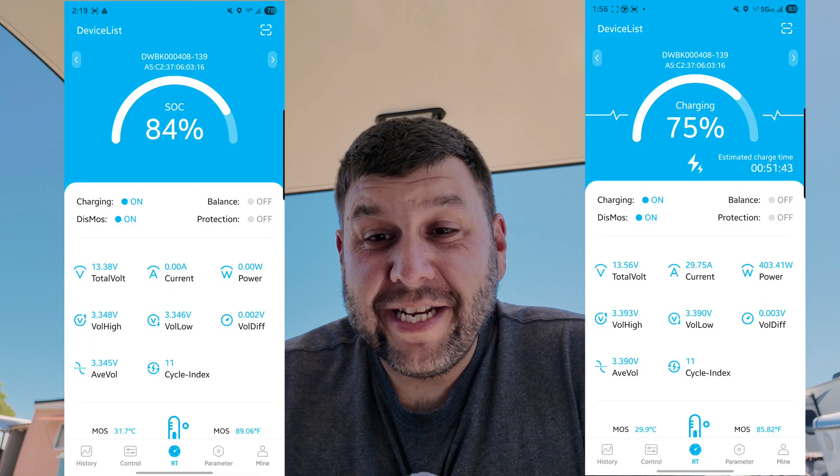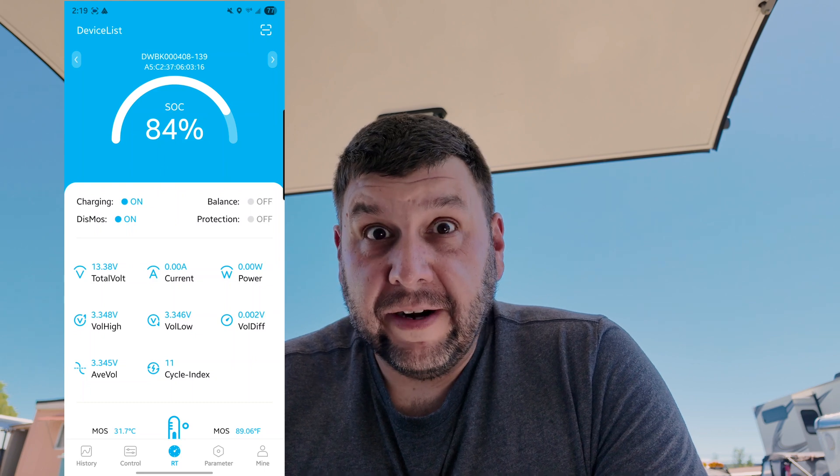The Bronco ran for about 15 minutes. I was checking in throughout — the positive wire out of the Victron got a little warm but nothing out of the ordinary for charging a battery. Let's see how much we gained just by upgrading those wires — almost 10 percent, so we nearly doubled our battery recovery. The fridge isn't running right now, but I had it on at its normal temperature and it kicked on a few times during the run. It is very hot out here today, probably 92 degrees. That is not a bad return on investment for some shortened wires and new extension cables — totally worth it. Now we can recover charge on days where we don't have good sun — this setup is for the cloudy fall and winter days of the Pacific Northwest, or anywhere you're running into cloudy days and can't catch the sun for a free charge.